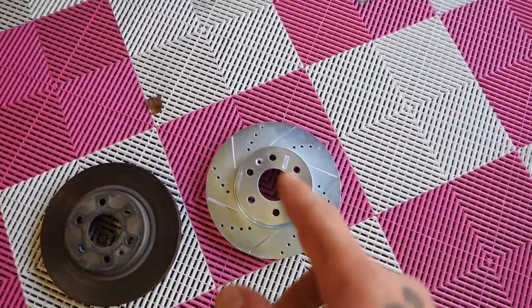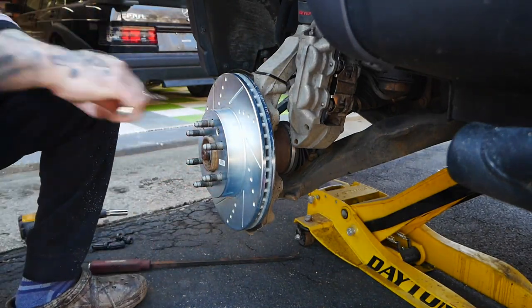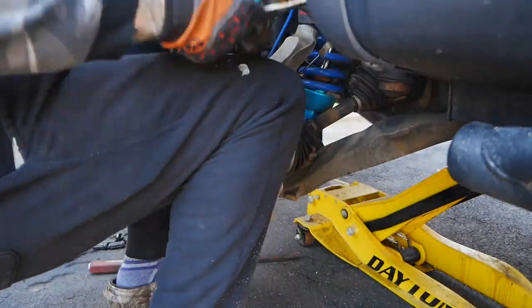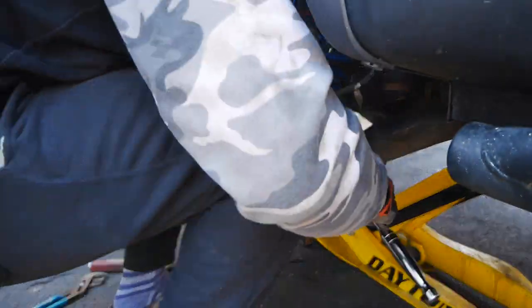It comes with a little layer of grease, film, oily stuff on it. So make sure you wipe it down with brake clean — which I didn't have, so I did rubbing alcohol a couple of times. Get whatever you can off of it. Now here's where the mildly tricky part may or may not be. I think most cars usually have to remove the caliper completely to change the brake pads. We could have gotten away with just doing brake pads, but we're upgrading the whole system.